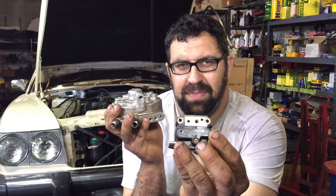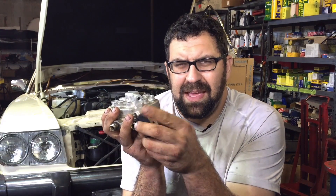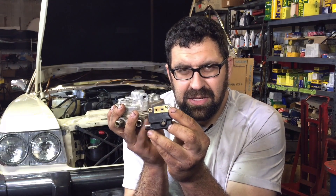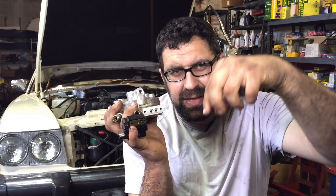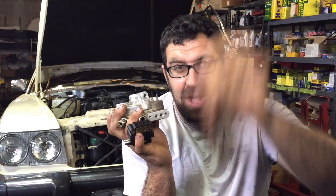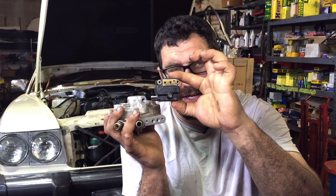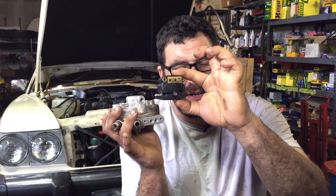Either way, this is a plastic-metal combination and because of that it can fail. The other thing is that when this EHA goes bad and you have a cold start condition where the car will not start, and you put your finger on the air flow meter plate and you have no detent — it's just all firm pressure — that indicates that this EHA is letting too much fuel past. It's not regulating pressures and you are now stuck with a bad EHA and the car won't run.